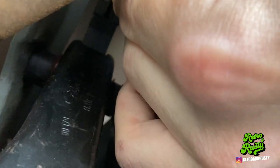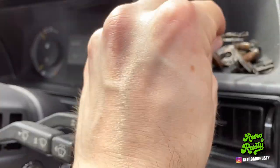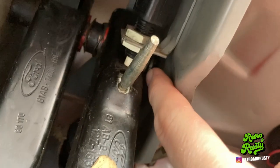The way you get that out is to just push behind it — pulled it forward and through. That's probably going to be a pain to get back in. This one came off the side. Next there's a brass clip, and then I'm going to have to pull this bar out and hopefully the clutch will just drop off.